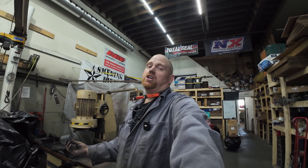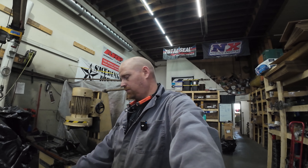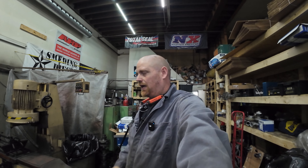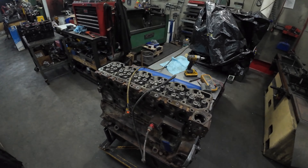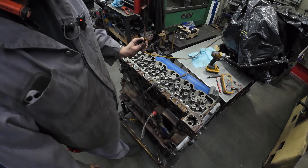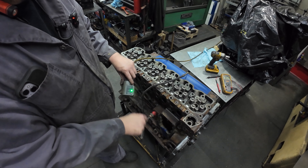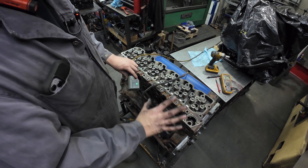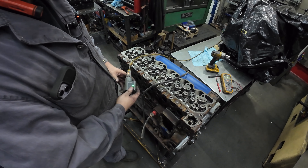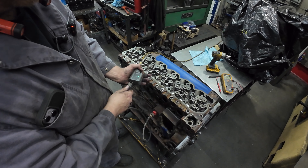If you're a car person, there's a pretty good chance you already have a multimeter, so you won't need to buy one of these. You can also check it for free — I'll show you at the end. But let's check it with this tool first. You'll need an extension cord already plugged in. Plug this checker into the cord and it gives you a green light saying the outlet is powered. I can only plug this in for a second because there's no coolant — you'll burn the element out if you leave it plugged in too long. Take the other side and plug it in.